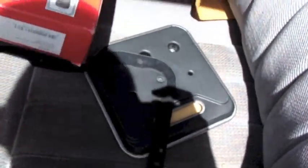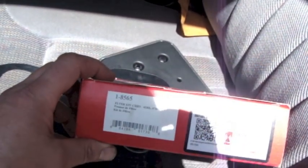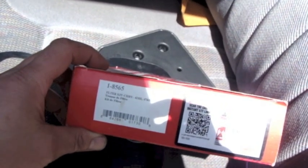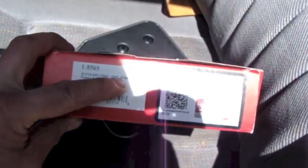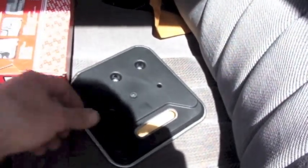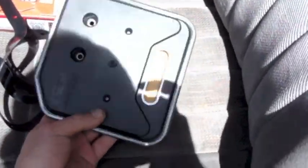I'm glad I went back to the auto parts store and asked the counter guy what the other choice was for my model year. He pulled out this kit, which is the 185656-5 filter kit for the 42RE. And this one actually says right on it 47RE. The actual gaskets are the same — the difference is the filter. That's my filter right there.